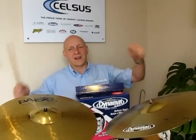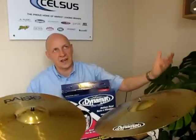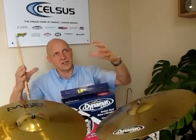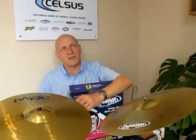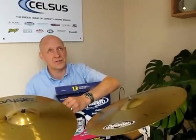And the guy in the orchestra at the back hitting the big gong doesn't hit it harder to get it louder — he hits it faster, he excites the metal. The same is with a car. The faster you drive, your car is one big body of metal, like this cymbal. The faster you drive, the more it resonates and the more all the panels move and create what we call road noise in the car. So when you fully Dynamat a car, you can get between a 9 to 12 dB drop of the noise floor, which is huge — that's half as loud to our ears.